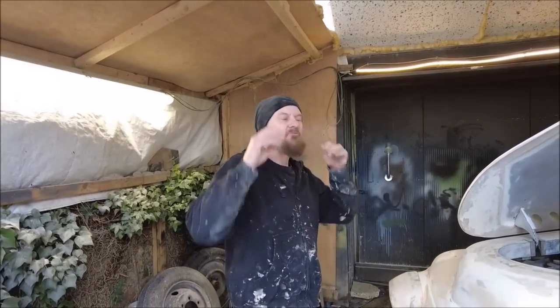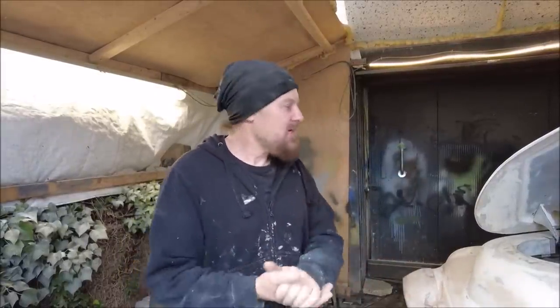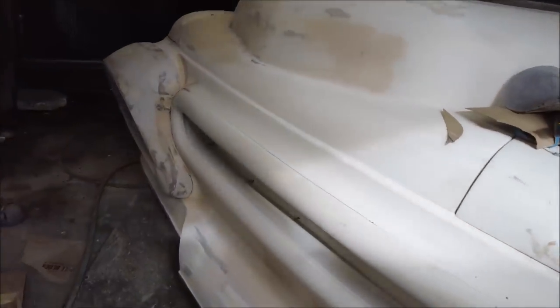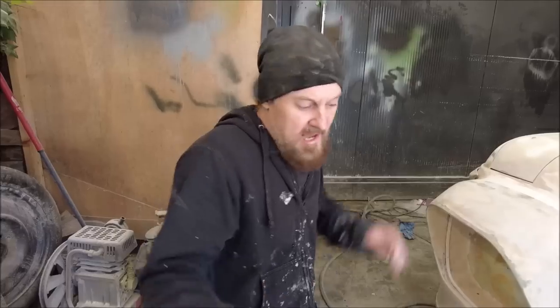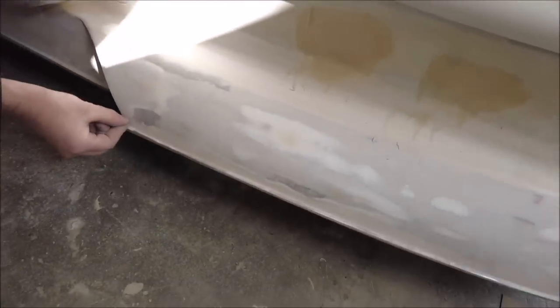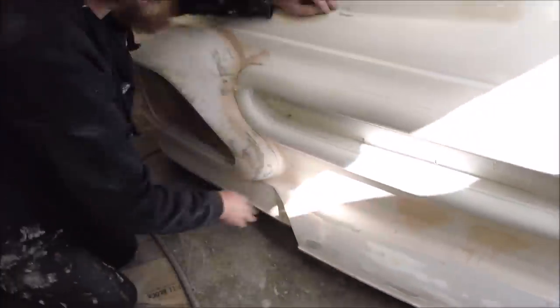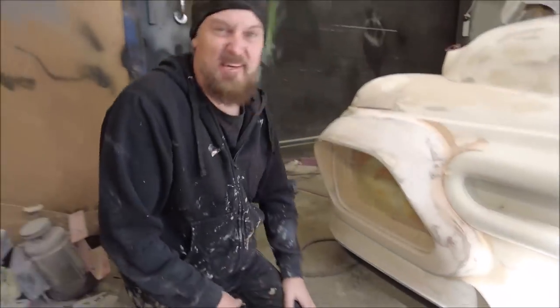The 60s truck — wow, we're really cracking on at the minute. I've got all my backlog of work out of the way and I can fully concentrate each day. Wake up, 60s truck, all day. So things are really moving. I've been looking at the front end of the truck, getting everything really dialed in. I've got some filler on here because I've got this masked up, ready to get that panel gap just dead right around there. Filled all the way down to this steel reinforcement, this skid pan just here. This is going to have a trim across it, because this will definitely crack away from that. So a nice chrome trim with a chrome bumper is going to look awesome.